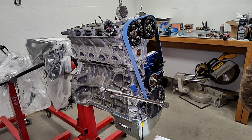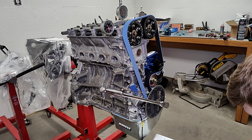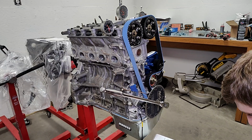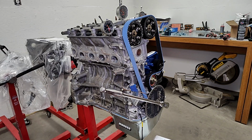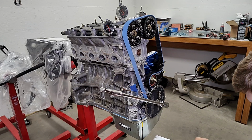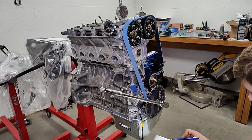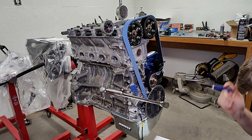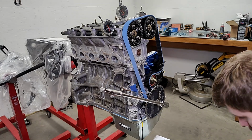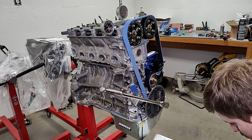271.5 divided by 2 gives me 135.75 minus exhaust close. Minus 25 gives me 110.75, and my exhaust needs to be at 112. So we're close, so we probably need to move that one like a degree. 33 plus 43 plus 180 is 256. 256.